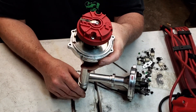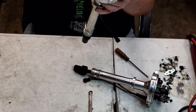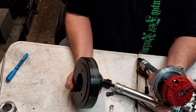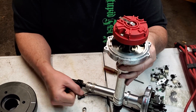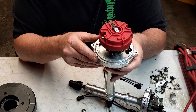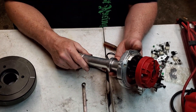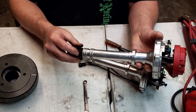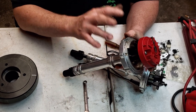Slide it wherever you're going to put your number one on your cap, lined up with your rotor button, and you'll be pretty close. Get it all back together, crank it up, get your timing light out — you need a timing advance light. Most of them show up to 40 degrees. On this balancer here it goes 50 degrees before top dead center, 10 degrees after — you're always going to be on the before top dead center side. We're going to dial this distributor around till we get 36, 38, or 32 degrees, whatever you're running, then lock it down tight.